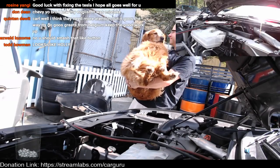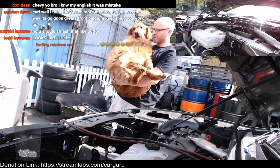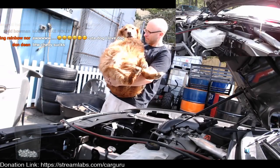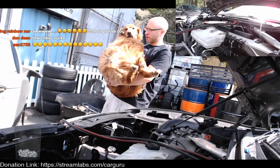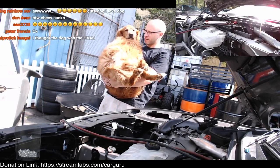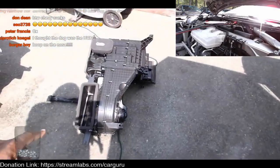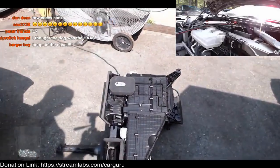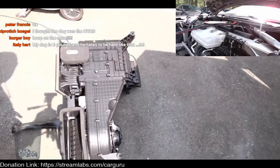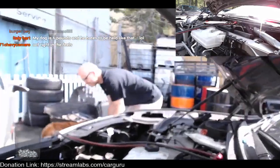All right, we're almost done with the extraction. We're down to like 5 psi. It's probably going to extract 1 kilogram. Okay, so we're down to 0.91. Again, this is the new HVAC system that's going in right here, and these are the 2 lines that we have to disconnect for the old HVAC system, and we're going to see what it's like behind that firewall of a Tesla Model S.